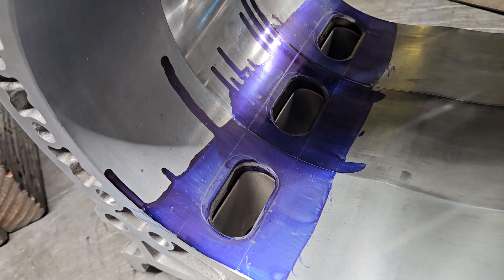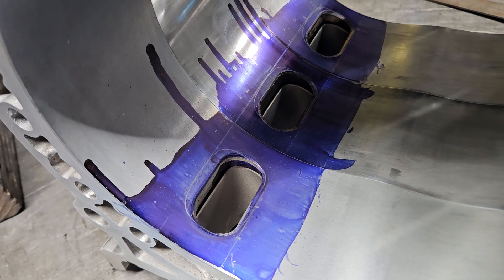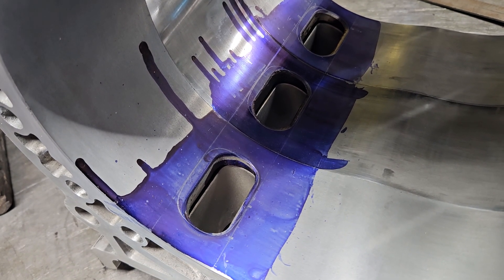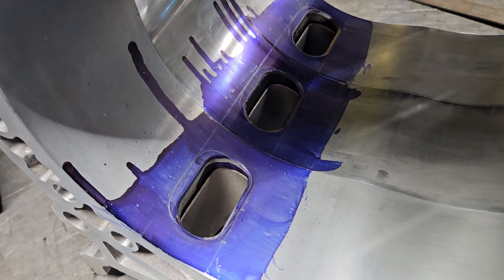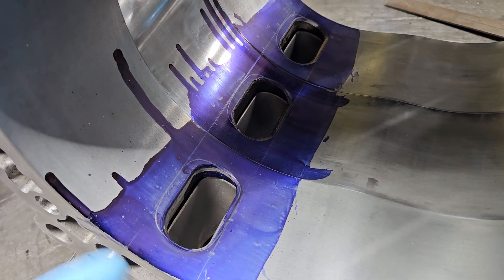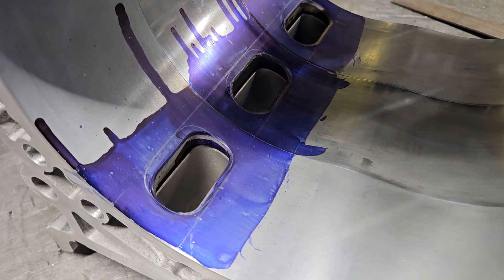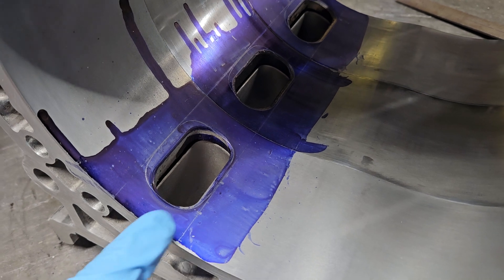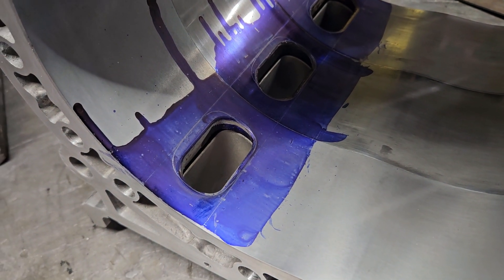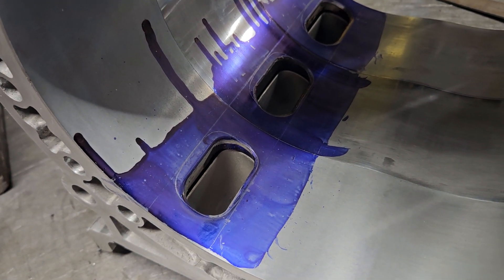Not that it would be exceptionally significant. If somebody threw these parts together and it was in a stock motor, no big deal. And if you're porting, you could probably accidentally match everything up just right. But I always double check, triple check. I love finding stuff like this — I find it interesting. Basically you have a slight variation in the new machined edge on the 20D housings, and just a slight variation in your port timing and in your port size.